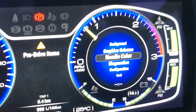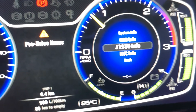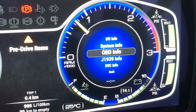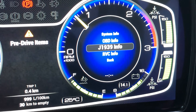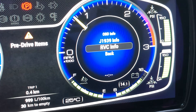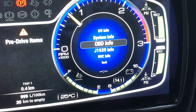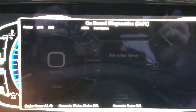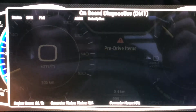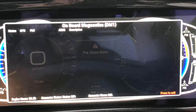Another really cool part of this is the onboard diagnostic system. You click into that using the rotary knob clockwise and then pushing the button down. We have system info, OBD info, J1939 which is our communications system within the coach, and RBC which covers all our different onboard systems — engine, transmission, and so on. OBD is going to be a very useful diagnostic tool. If you have an engine check light or warning lamp come up, you can scroll into this menu and it will list any faults it's currently got — super handy for diagnostics when you're on the road.